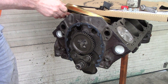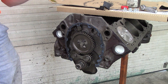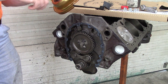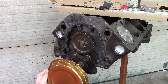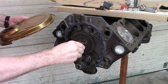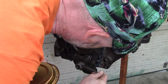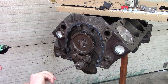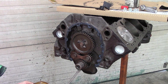Once that is in place I will put a little bit of lubricant on my seal before I put that in, because after I install the cover it will be a little bit harder to get at. I'll also put a little anti-seize — never-seize, copper plate. This one isn't copper but I like to put that on so the next time, if there is a next time, that I end up taking this apart, it makes it a little easier to disassemble.